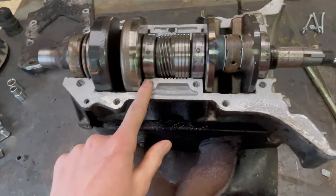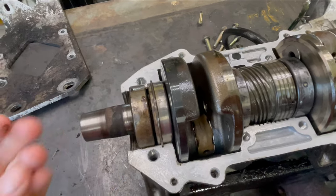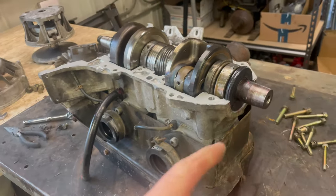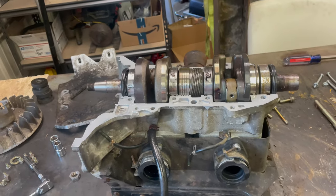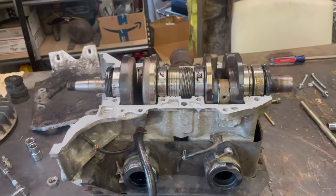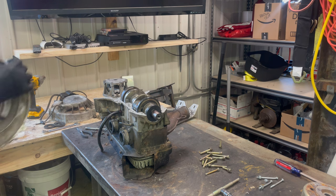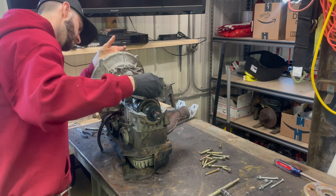So we're now going to grease up the crank seals, clean up the RTV, and throw them in. I greased the inner diameter a little bit, put a little bit of a dab on the outside of RTV. So I did that on that side as well as this side. I'm just letting the RTV dry for a minute or two, like the directions say, and I'm gonna put the two halves back together. Hopefully this solves that problem, or maybe I just screwed it up. We'll see. Okay. Easy now.